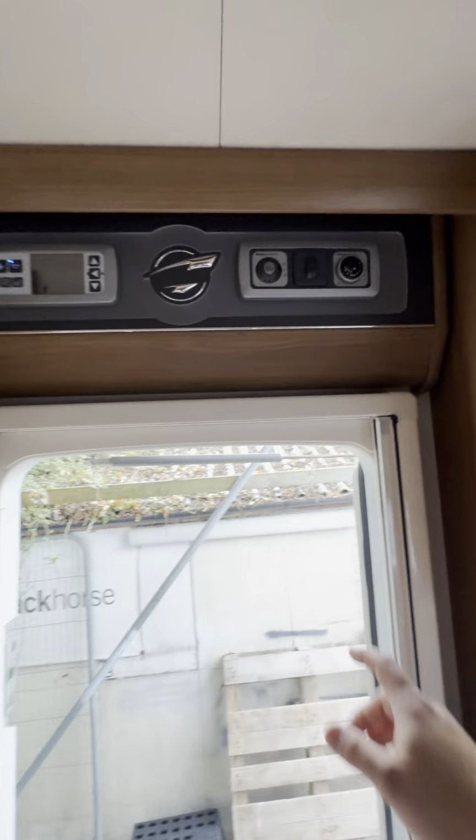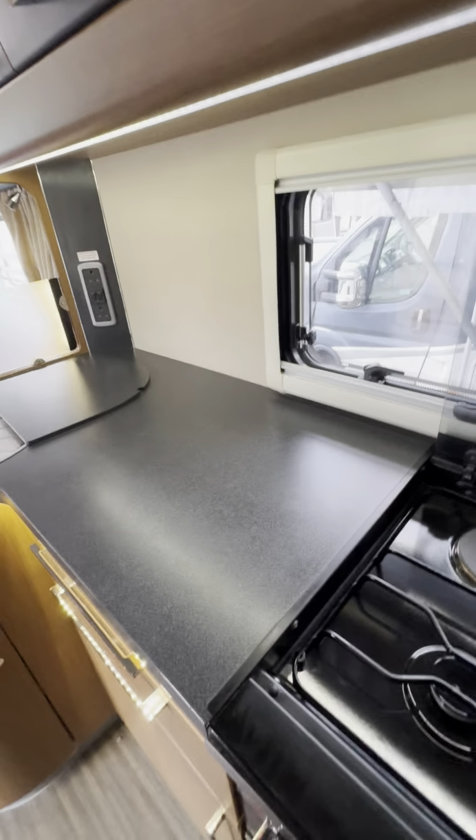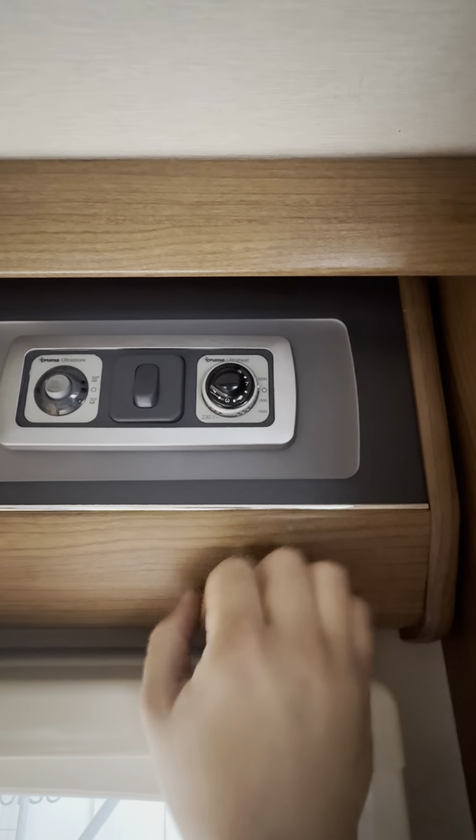If you use the space heater on 2000, that's 8, so you're then on 9. And then essentially, if you use anything else on the mains, if you try to use this electric ring here, you're going to go over your maximum straight away. So I would always recommend using it either on 500 or 1000.